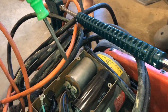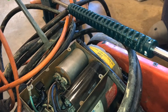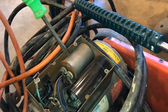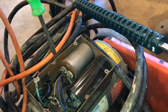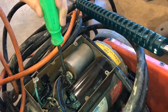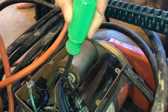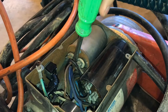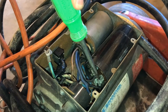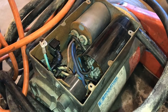The final check: use a screwdriver and touch the two terminals. This can be very dangerous if you haven't already discharged the capacitors — you're only doing this after checking with the meter and confirming no voltage. When you do this, don't touch the screwdriver to any other metal, just the two contacts. I'll touch one side and slide across to the other — nothing going on. I'll do the same on the second capacitor, and there's nothing going on. Both capacitors have been fully discharged.